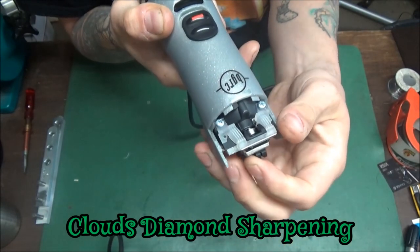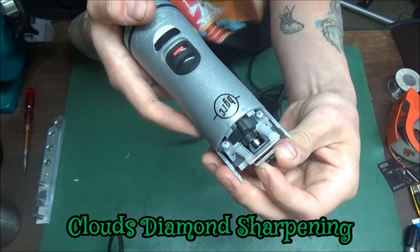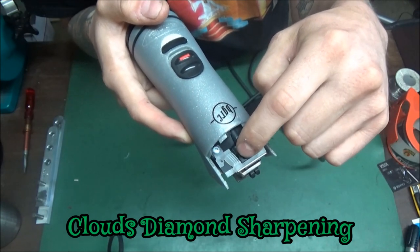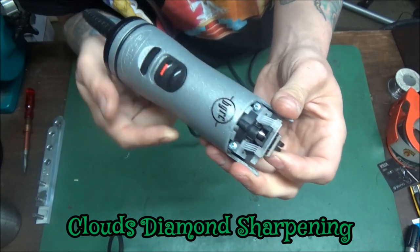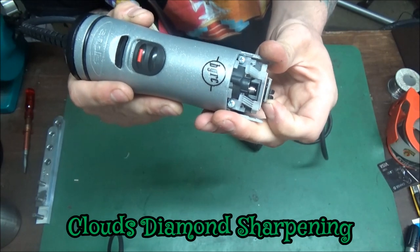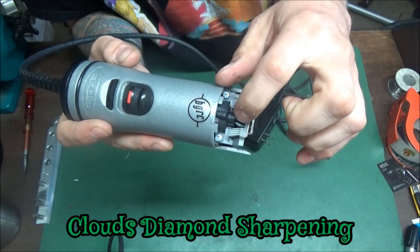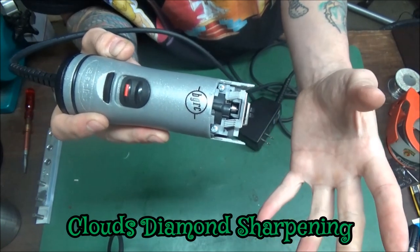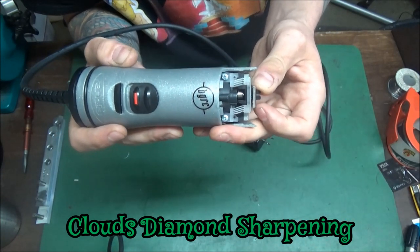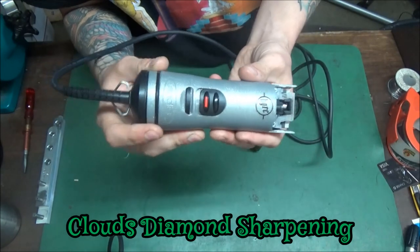They make newer kind of drives that don't have the metal. But if there's any play in this, either the bearing is broken or the drive is messed up. Sometimes if the bearing is broken it will melt that plastic in there, and that's not good either. You don't want that bearing getting hot because your clipper is not going to run very fast — too much friction. It melts the insides and causes play, then leaves lines in the haircut. You want this to travel 100% so it gets all the hair — all the way. So let's get to work.